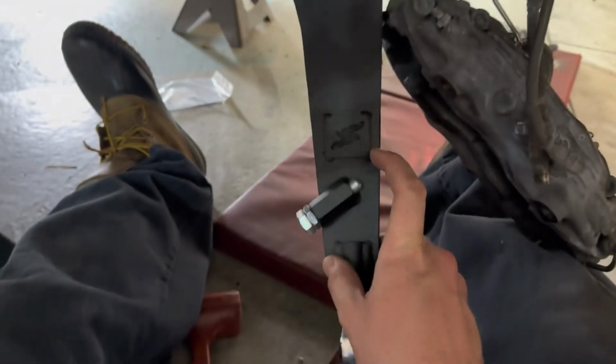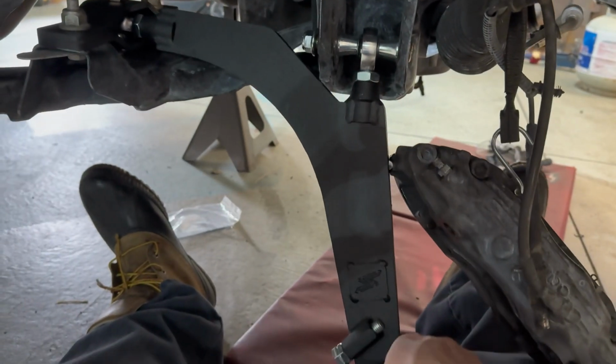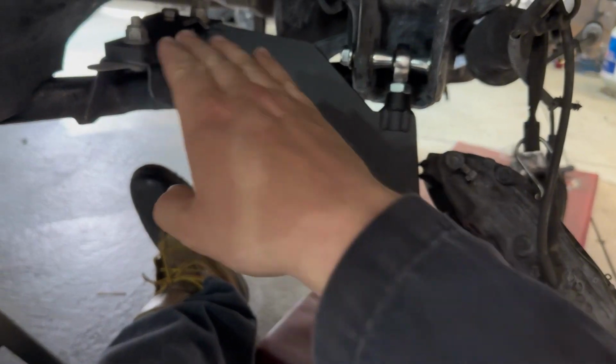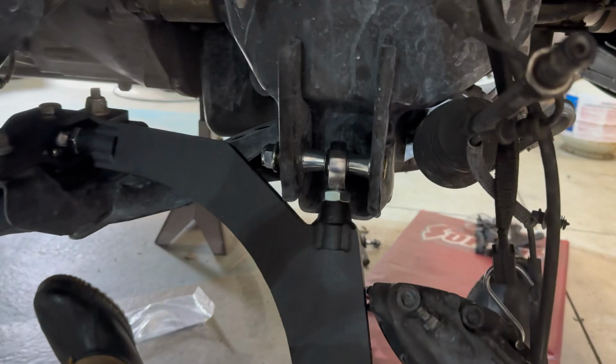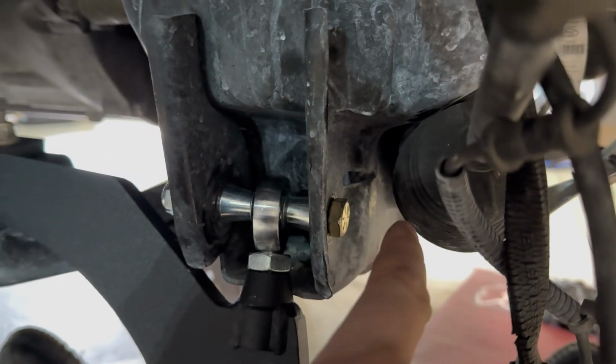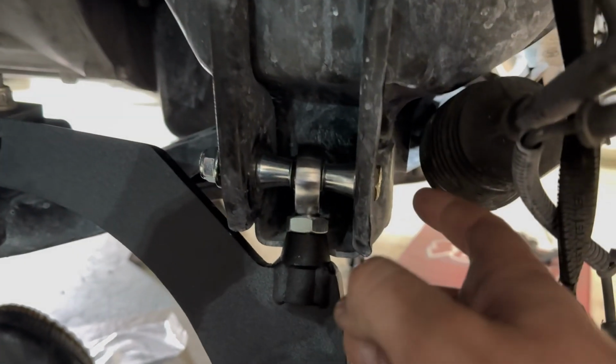First, the orientation. Your bump stop needs to be facing up. So this is the correct orientation. And then if you just removed your control arms, you know that swooping way goes back. So this is the passenger side we're looking at. Now, a couple things they point out. You have a new bolt for here. You don't use the stock bolt, okay? So you put a new bolt in, you run that bolt through.